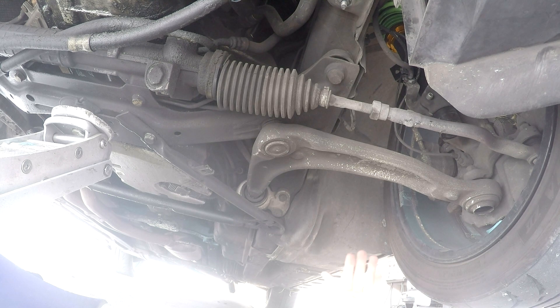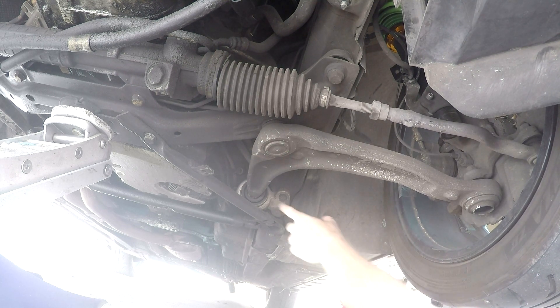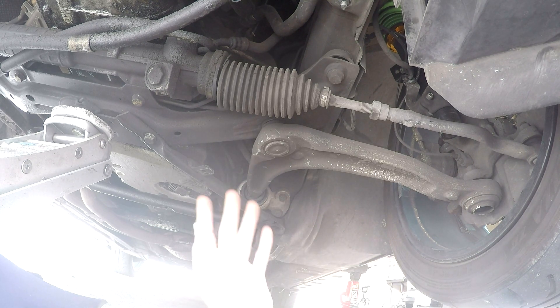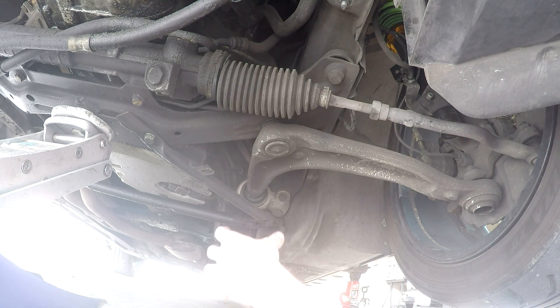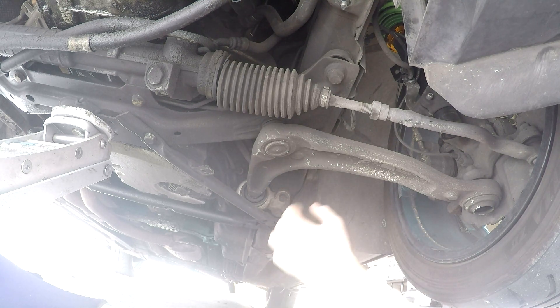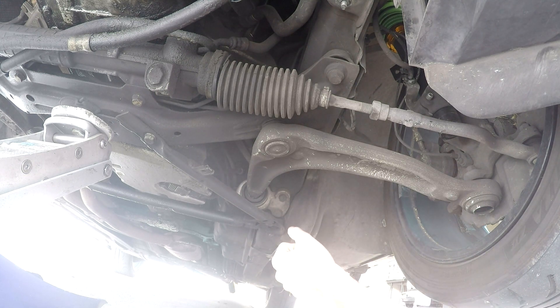Now at first glance these bushings look okay even though they're soft rubber, but you want to see why we're upgrading these. I'm going to focus the camera on the front control arm bushing. Now I'm going to grab the driver's wheel and just pull it front to back. Watch the bushing. You can hear the bushing making a squishing sound and you obviously see all that side-to-side and front-to-back deflection in the bushing. When you're driving on the street normally that's fine, but when you're on the racetrack really pushing the car hard, all that deflection gives you a really loose, vague steering sensation and it's actually causing dynamic alignment change — and not in a good way. Basically you could be dynamically losing or gaining caster and camber as the car goes over bumps and the steering undulates going around corners. By going to a completely solid bushing you're eliminating all of that flex, giving you a much more solid steering feel.